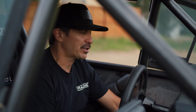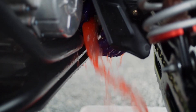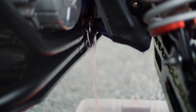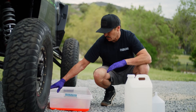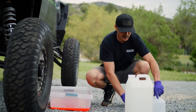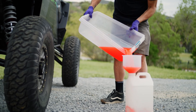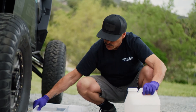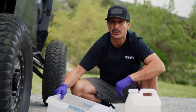I'm going to run the car for a minute, get the car up to temperature, shut it off, and then go ahead and drain the flush that we have in there. Once you're done flushing the whole system out, we're going to take our mixture of coolant, vinegar, and water and fill a container so we can transport it to a proper waste site. Make sure you clean out any of your bins that you use for coolant, especially if you have any pets, because it will affect them.